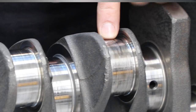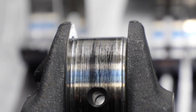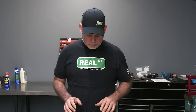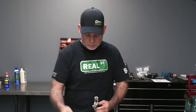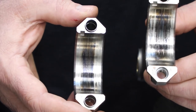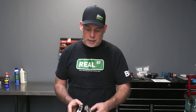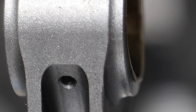On the crankshaft, the discoloration on the journal — you can see this rod journal will have to be resized. All the rod journals will be resized. The crankshaft is not actually bent, so it'll be serviced and put back into another engine. The rod that the bearing failed on has this discoloration that is not going to go away — this rod should be thrown away. Anytime you create discoloration on a connecting rod, I would not use that rod again. You can see that the pin bushing has been squeezed out of the small end of the connecting rod.